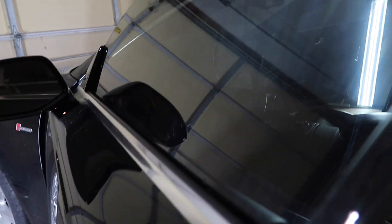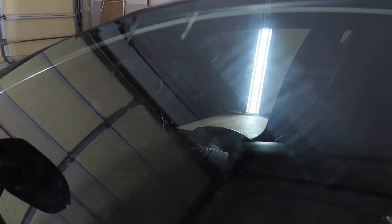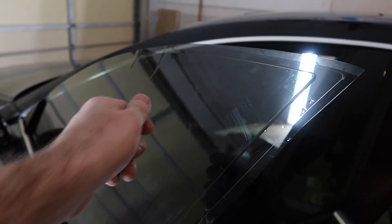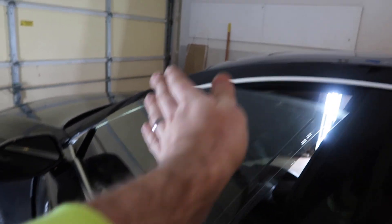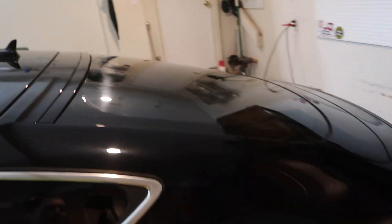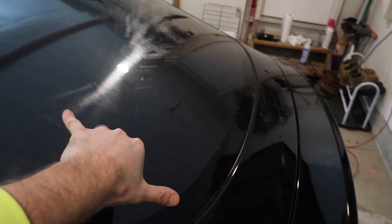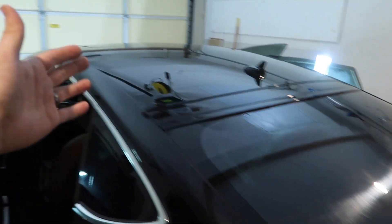Here's what it looks like after we shrink it — there's no more fingers on the bottom, a couple on top, but those will go away; that's just water wanting to run back down. You can see some scratches on the film, but that's just the liner — basically like a screen protector for the tint. We're going to peel that off, put it on the inside, and call it a day. We also shrunk the back window. It's the same thing — you'll have really big fingers on the back because it's the most curved piece besides the windshield, so it takes a little bit longer to shrink, but still not too bad.